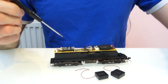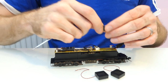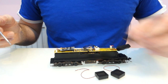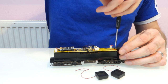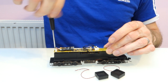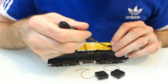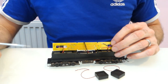First thing you're going to need to do - if you've not upgraded your speaker yet, you're going to have a sugar cube which will be just here on the circuit board. But to access the screws for that you've got to take the circuit board off. So you've got six screws - I've already taken four of them out just to save a bit of time. Underneath there are two screw holes, so you would usually have two screws in those holding the sugar cube from the top. Once you take those out the sugar cube lifts off.